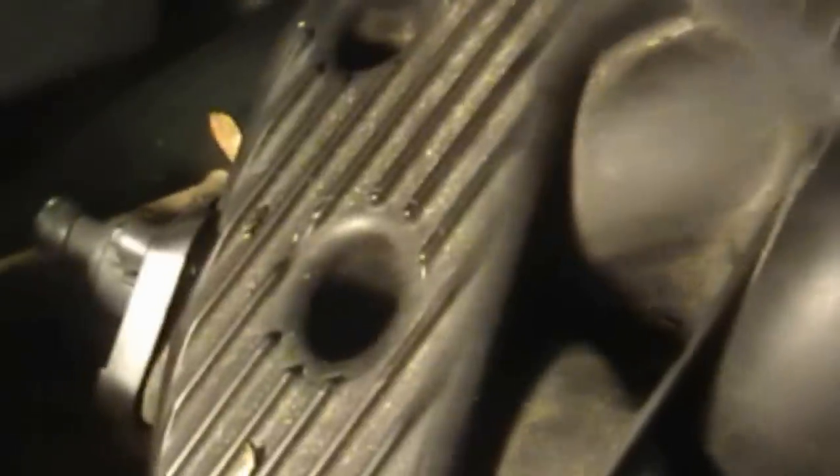I found a few things that no one mentions online or in the manuals about how to pull these heads off. First thing I did was take the plenum off. There are little bolts in there - those are eight millimeters. You got one, two, three, four, five, six, seven of them. Use a little deep socket. There is one hidden bolt I want to show you - it's right behind where your throttle cable hooks up. There's a really long bolt there.